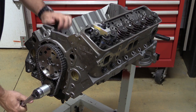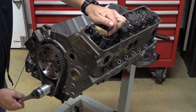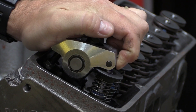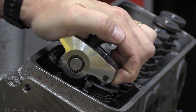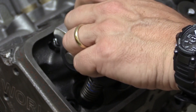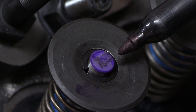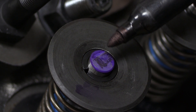By hand, gently roll the engine over a few times to cycle the valve train through. One issue you can run into is that the roller tip rolls too gently over the top of the valve stem and doesn't really make a mark, especially if you're using a Sharpie. One thing you can do is hold your finger over the roller so you keep it from rolling as it goes through — that helps make a better mark. Go through about three or four rotations and you should be good. The lifter is now back on the base circle of the cam, so pull this off and you can see the mark. It looks like it's just a little bit too high — towards the upper third of the valve stem — and I'd like to move it down a little bit.